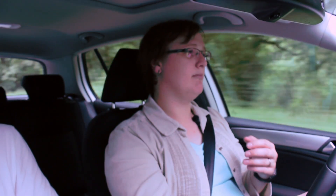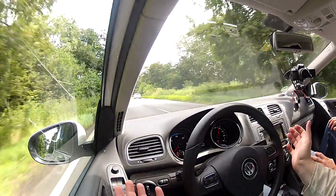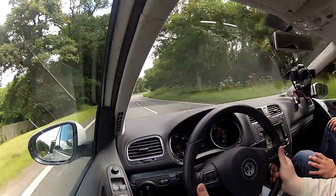Alongside the plethora of ways that Volkswagen lets you control the regenerative braking of this Blue E-Motion Golf, it also allows you multiple ways of controlling the energy that you consume. Like most electric cars on the market today, there is a normal mode and an eco mode. In normal mode, you have access to the full 85 kilowatts of this car's electric motor. In eco mode, it gives you a restriction on how much power you can use. You still have a kickdown function, which simulates the kickdown you'd find in an automatic gearbox and gives you temporary access to all of that power should you need it. In range mode, this car restricts everything — it won't let you use the air conditioning or the heater, and it restricts the amount of power that you can send to the wheels. In that mode, obviously, you're going to get the best range, but I haven't really driven in that much because, quite frankly, with the addition of this regenerative braking setup, I haven't felt the need.